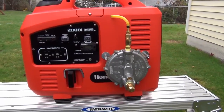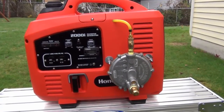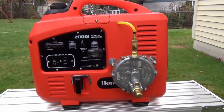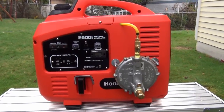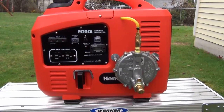I've been wanting to do a natural gas conversion on this — a tri-fuel conversion — and there really isn't a kit out there. I've got some pictures of the inside. Normally with the kits you have to install an adapter between the carburetor and the air cleaner, but there's just not room on this; it's pretty compact inside. So I went ahead and did a conversion.